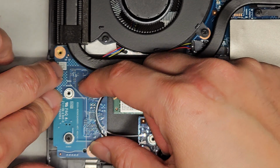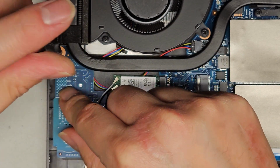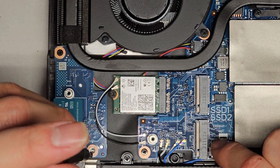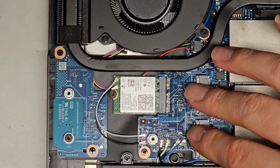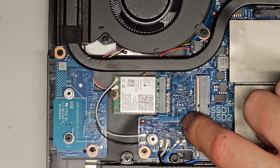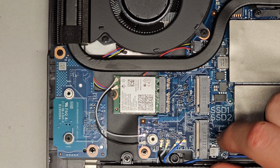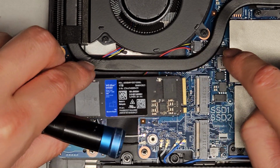Right, so we're going to get this back in. Okay, took that out for nothing. Well, I guess we're kind of just seeing what's in there. Again, on some models they probably have some function there. Also, this has two slots. So there's another slot for an M.2 PCIe NVMe SSD, it looks like. Also, oh, here you go. I think NFC USB. So there's this part here, which it looks like this would be where the other latch goes to. So one would go to, the flat cable would go here, and then it would go underneath this board. Okay, we're going to go ahead and reattach this. Also, you can see the fan connector right there.